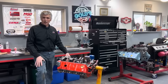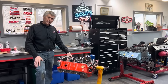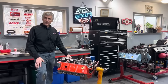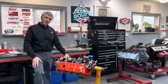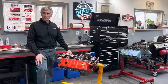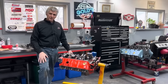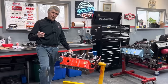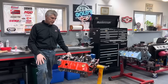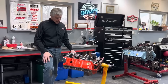You can build pretty much anything you want — easily build as much power as you want. The equalizing factor in the rules is it's a 2,500-pound car on an eight-inch tire, and the tire is an equalizer. On a circle track, typical lap times are about 14 seconds — maybe three and a half seconds on each straightaway. Power only helps when your foot's all the way on the throttle. Weight hurts all the time. Where you put the weight is critical, but back to the engine.